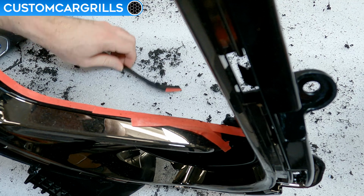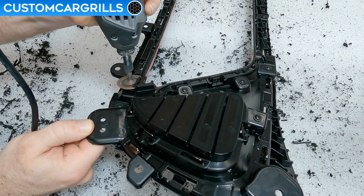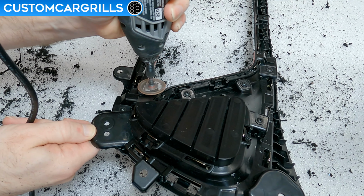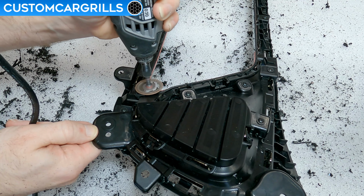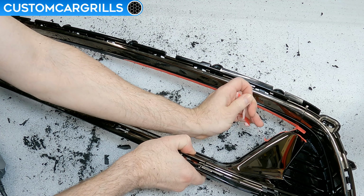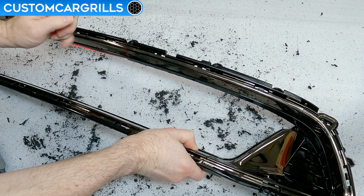There's now going to be a small cut on the back for the corner to join the two edges together. This can be a tricky cut because there's no guide, but it can be done by aiming a little higher than the cutting depths on the edges just to get it started. Then use the top of the shaping wheel to whittle down the corner until it matches the depth of the other areas. Once this area is blended, then let's go back and remove the tape from the center section and turn our attention to the side sections.